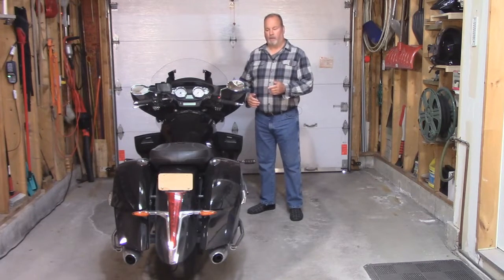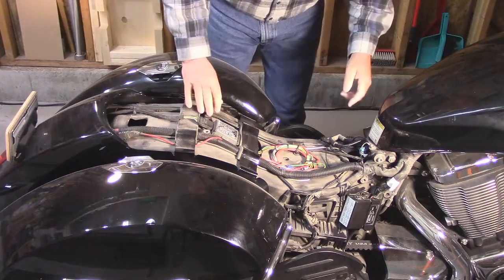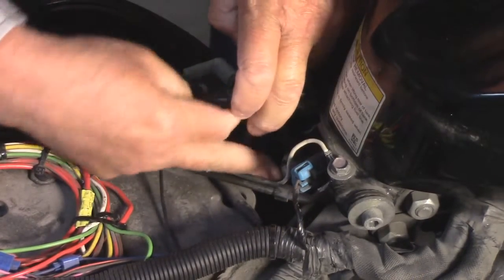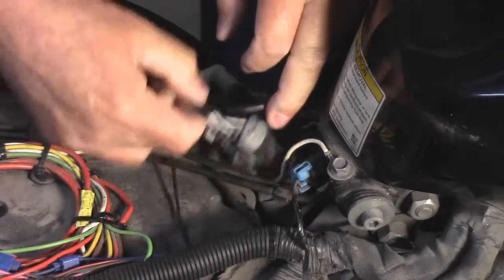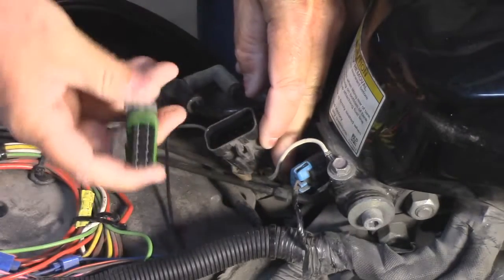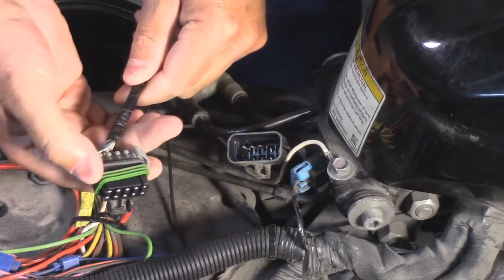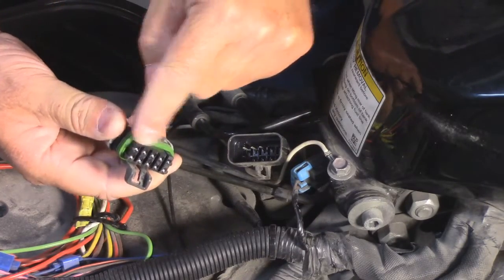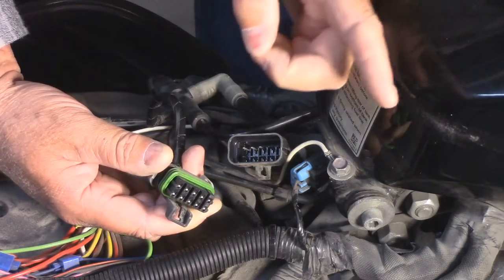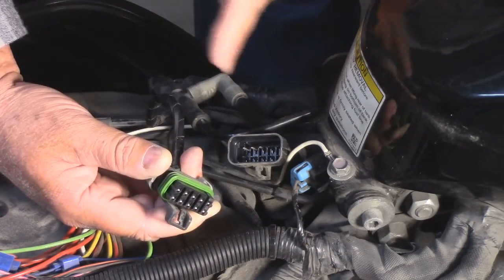Now let's take a look at the cruise control module itself. It's underneath the seat — Victory in all its wisdom stuck it way down inside that hole. This right here is the 10-wire connector used to power the module. The female end is the wiring harness and the other part goes down to the module. If you need to know if there's power here, this corner pin — pin A, the white with blue stripe — that's your power, that's your 12 volts. Remember, the red LED on the control panel will be lit even though you may not have power here. So before the dealer wants to charge you big bucks for a new module, check your pins.